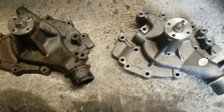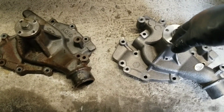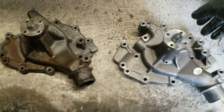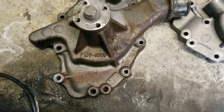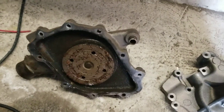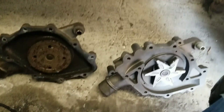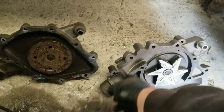Alright, here are the two water pumps. This one is obviously the more common style, and that one is what a lot of people call the nine-bolt or agricultural style. There's the casting number — it's F1J... F8505. Pretty much they're exactly the same; the only difference is that one doesn't have this pocket right here.